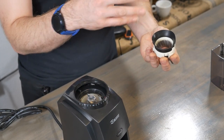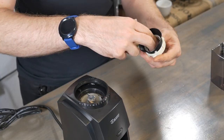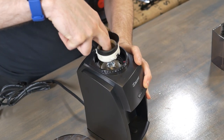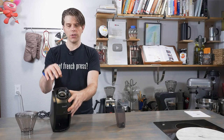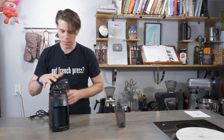We're used to rubber being non-slip, but that's not really the case with this. So if you manage to get it on with the burr out, I've found a trick: take your two fingers and put them inside of the burr and hold it like that. Then line up the red wing with the red line and just drop the burr down, trying not to touch the gasket. I know that's a little fidgety. I'm also going to show you how to do this with the burr inside of the Baratza Encore. Once you've placed it, just make sure that it's staying in place.